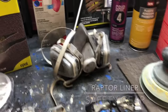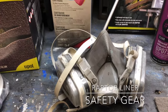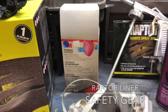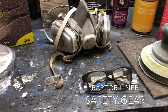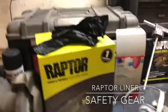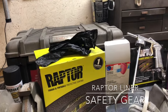Safety equipment: a basic respirator with charcoal filters. I use 3M brand. You can buy these at Harbor Freight or Home Depot. You could buy the disposable like I got, or you can buy the more expensive permanent mask where you have interchangeable filters for different applications. Next, safety glasses. When you're spraying this stuff, there's going to be times where you're spraying in corners and underneath — it's going to want to blow back onto you. Safety glasses will definitely save you because this stuff will sting if it gets in your eyes. I wear gloves when I'm working with this stuff. It's hard to get off, it smells bad, and it will ruin your skin. It's not healthy for you.